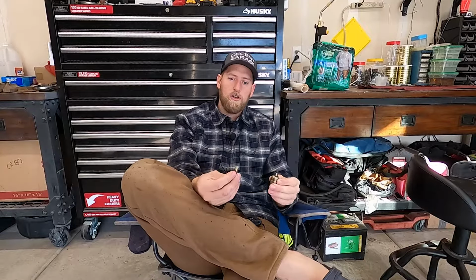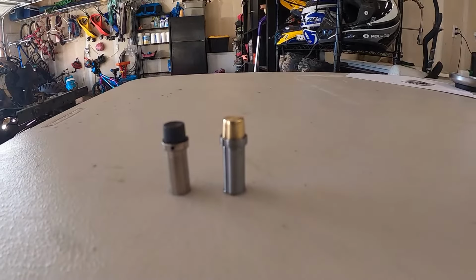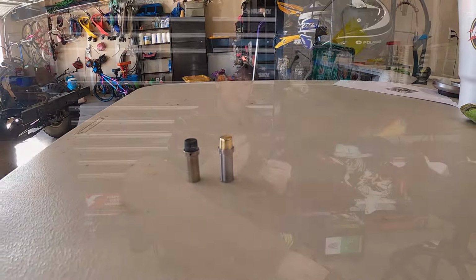Part of the rubber plunger had come off, so it was blocking some of the fuel supply, and it wasn't running as efficiently as it should. So another part of the story is I tried the part that I'm going to show you today that fixes this, and this was 3 years ago, and it didn't work on my truck. So the product I'm going to show you guys about today is a plunger, same design, but it has a brass tip on it that's pressed in. You don't have pieces of this tip breaking off, and it still shuts off the fuel supply.